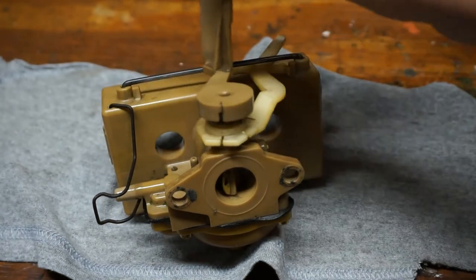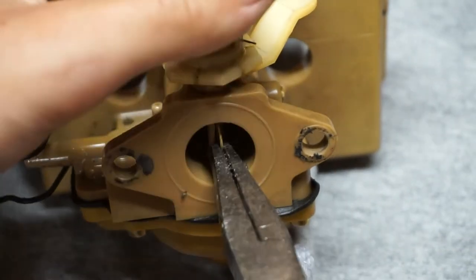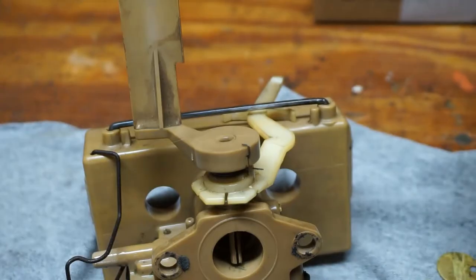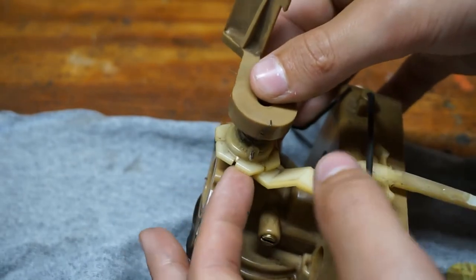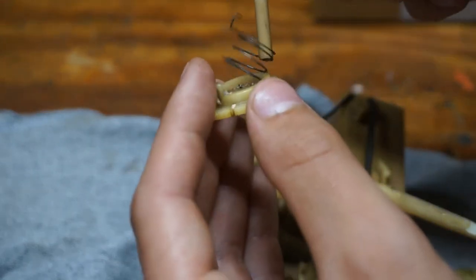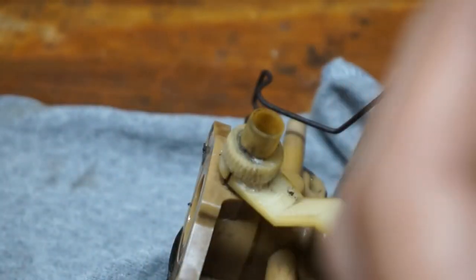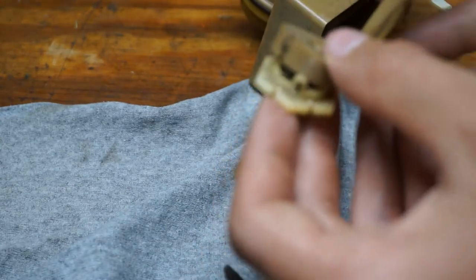In the opening in the back of the carburetor, you can see this little bronze piece. We need to pull that out. What I'm going to do is just take some pliers, hold the air vane, give it a little wiggle, and it should pop out just like that. Now that our little disc is removed, I'm going to come up here and pull the air vane out. You can see how the spring catches on this little piece here. Pop that off, just pull it up and slide the whole air vane assembly off — here's the spring. The spring actually kind of hooks on there like that.